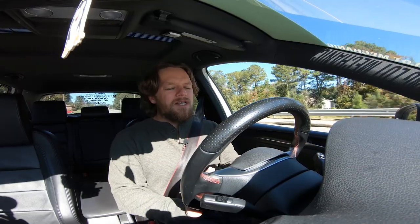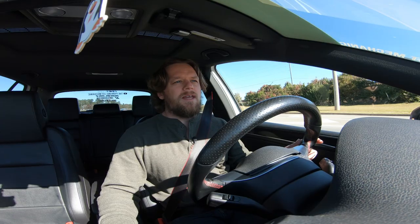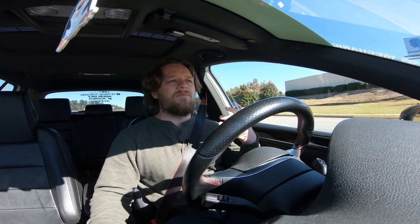The reason it clunks as well is because Volkswagen, in their infinite wisdom of engineering, decided to add a little bit of movement, or at least the availability of movement, in the subframe around the bolts. Don't know why. Someone might have explained it on the forums, but I couldn't have cared less. Over time, the bolts stretch and they're not as tight, so the subframe moves under acceleration and deceleration, and it causes that clunking noise because the subframe is moving around, hitting against the bolts.